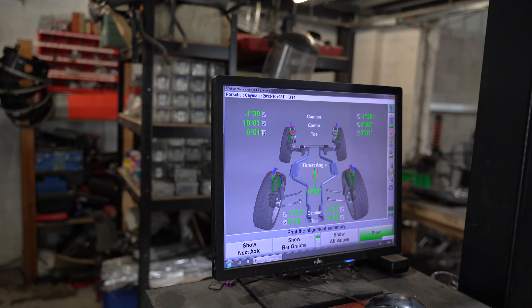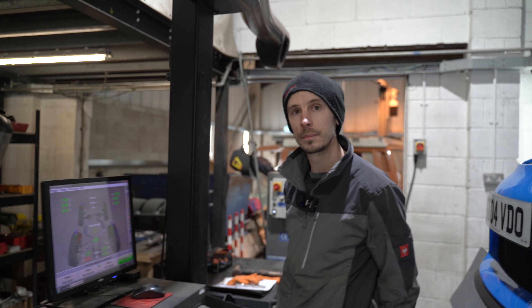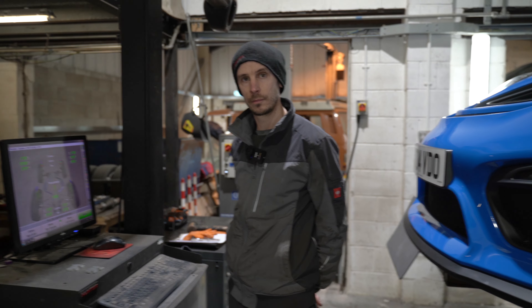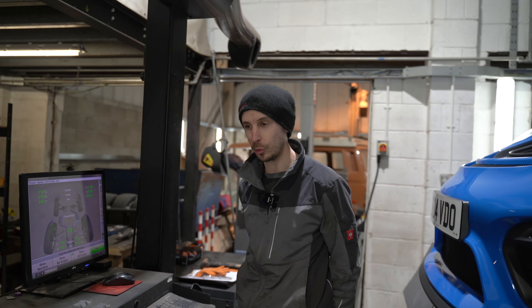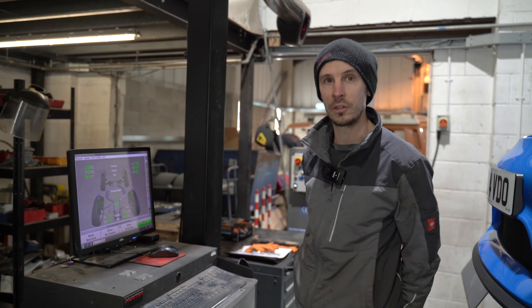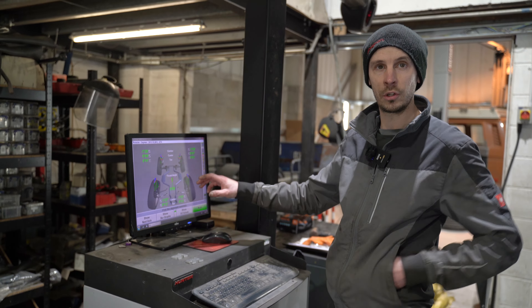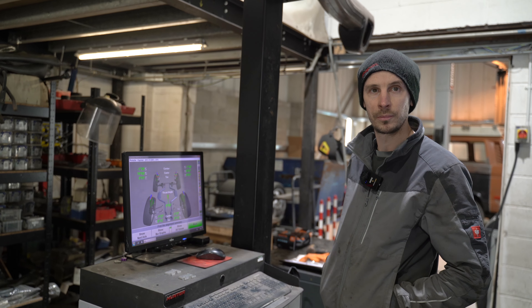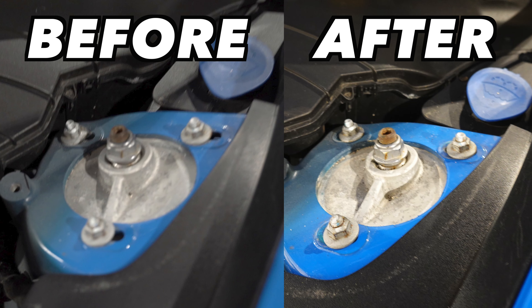It's raining but we are going to drive it. We always measure twice, cut once — we pride ourselves on repeatability. I set the values, push the car off the ramp, ask the equipment to forget what I've done, then re-measure and we should get the same results. We've done that twice while you were drinking tea. Also, looking at the top mounts now — are they generally centred? Almost exactly in the same place as each other — excellent.